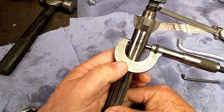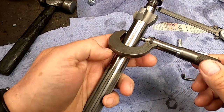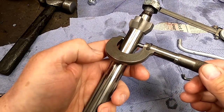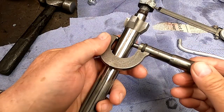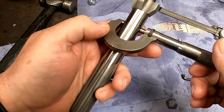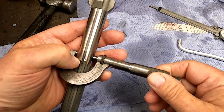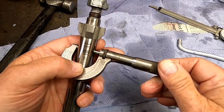One of the other essential checks that has to be done when you're looking at the main shaft is just to look for wear. Wherever the sleeve gear bush rubs on it, it's possible for this shaft to be worn. I've seen some of them that are down quite a bit. Obviously the bronze bush tends to last a little bit longer, and it's the hardened shaft that seems to suffer. As it happens, the shaft I'm putting in, there is a barely perceptible suggestion of a taper, and I'm happy with that, given that this is mature. So anyway, it's something which is easily checked, and there's barely perceptibly half a thou in. Anyway, I'm happy with that.